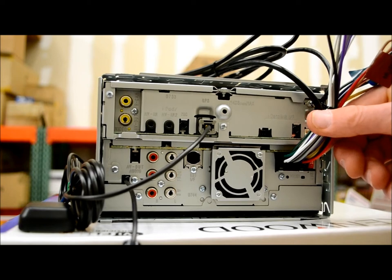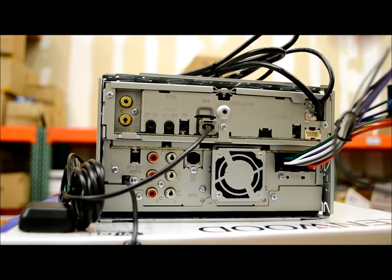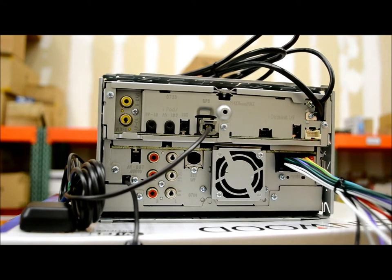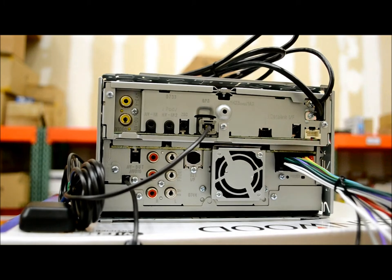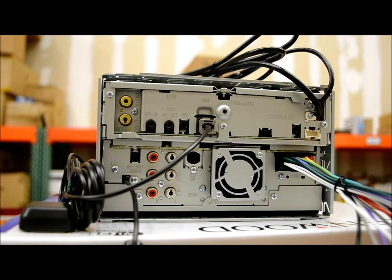Also very weird is that the plug is actually upside down. When I first went to plug this in, I thought the radio was in upside down — I actually realized the plug on the back of the chassis is upside down. But if you need to replace the harness, it's easy enough to do — these are dime a dozen. Over here, you have plugs for the Maestro, which is basically set up for expandability into cars that have sync-type functions where your climate control, heated seats, and all your climate settings are built into your existing car stereo.